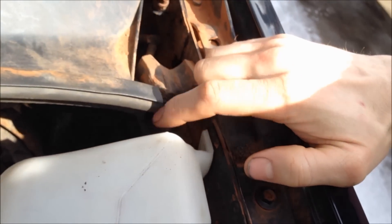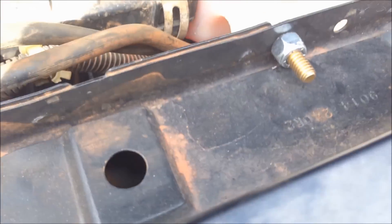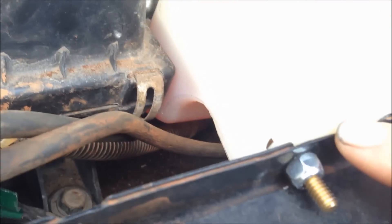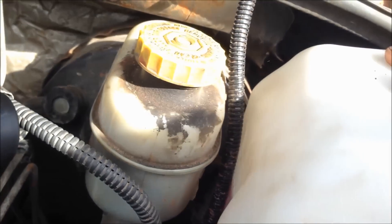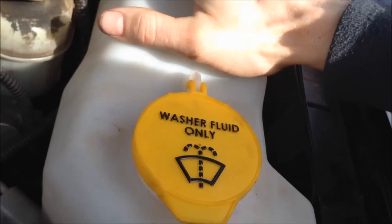Test your switch and make sure you've got the hoses hooked up to the right pumps. I did not use a bolt in the back because I had to cram my Viper alarm back in there still somehow, so I didn't have space. I just ran a quarter inch bolt through this pre-existing hole here on the pinch weld. It's still pretty solid.